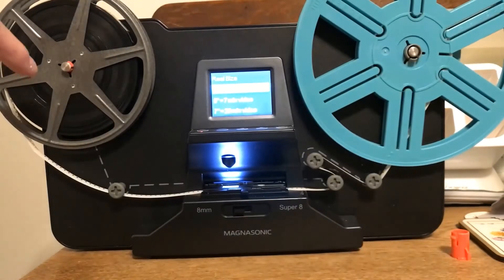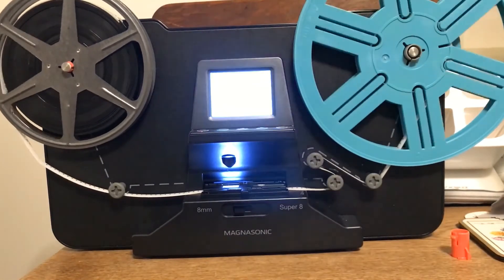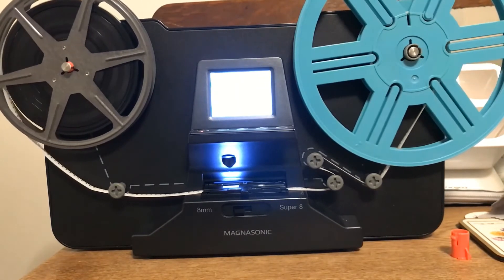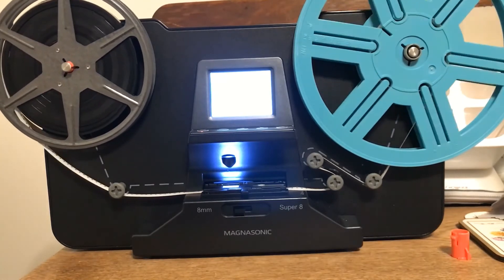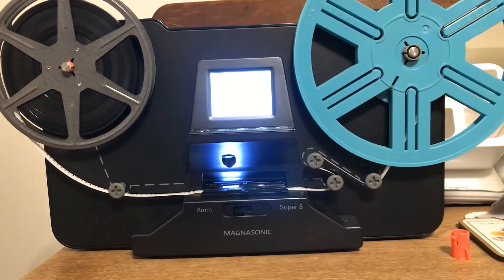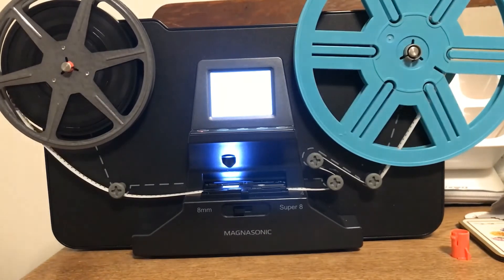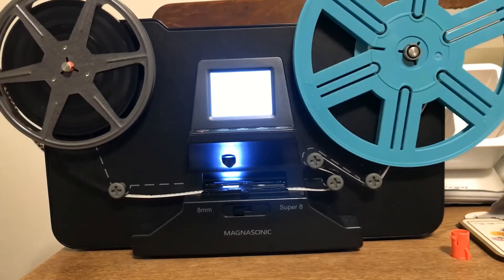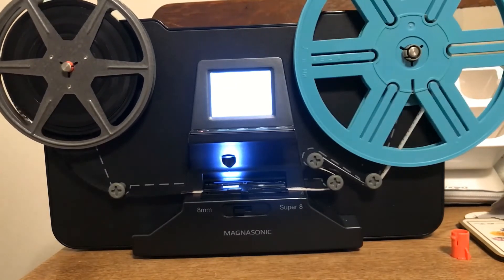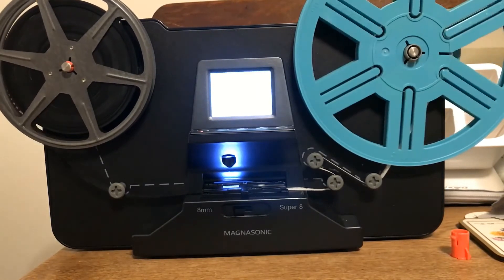The way to start it is power. This is a three inch reel, so you pick your reel and start. I already have the viewfinder set up and there is a menu for that as well — right, left, up and down. I suggest you zoom it in a bit, and then if the film tracks a little bit, you won't lose the picture and have something on the edge. Remember, these were cameras that had three lenses and everybody just centered everybody else. This will play back at 30 frames a second, and I'll show you in Handbrake how to take it down to 20 frames a second, which is very close to the 16 frames a second that 8mm film used.